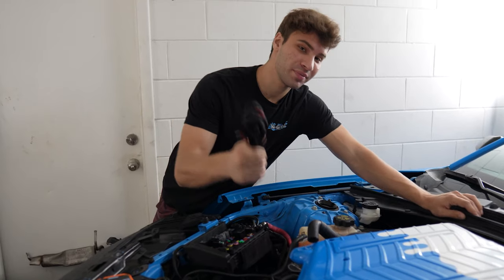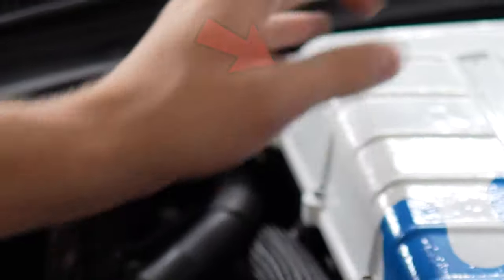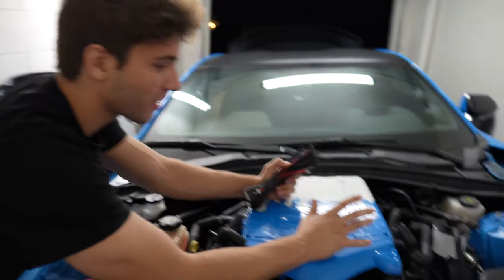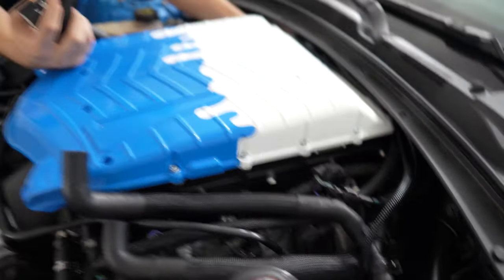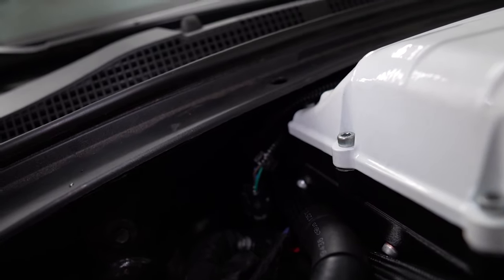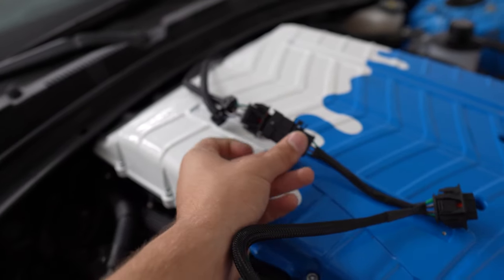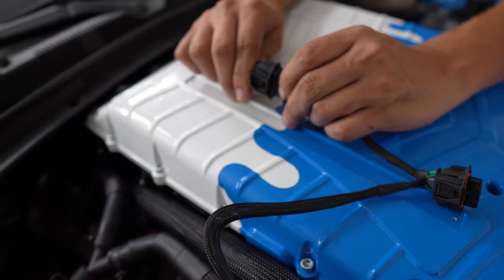The first thing we need to do is plug in the MAP sensor connector. With the supercharger, it's actually located behind it on the left-hand side. If you have a naturally aspirated car or do a heads-cam build, it's right here at the factory location. We're going to go to the back of the supercharger and unplug it. For a supercharged setup it'll be at the back left — same for Magnuson and the LT4. We take the connector off the back of the Whipple and plug it into this wiring harness as instructed.